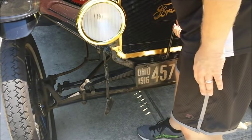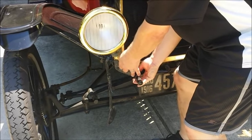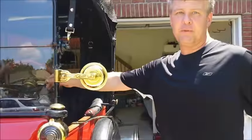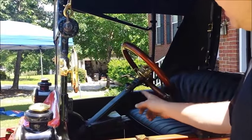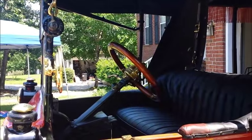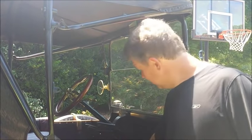It didn't start that time, so I come down again. There you go! This is your choke in case it doesn't run. Normally you try to advance it pretty quick after you start it and give it a little bit of gas. A lot of times you'll have someone standing back here. I've gone down four or five spots and it's smoothed right out. If it's real cold, you'll have to be up front pulling the choke to give it more gas.